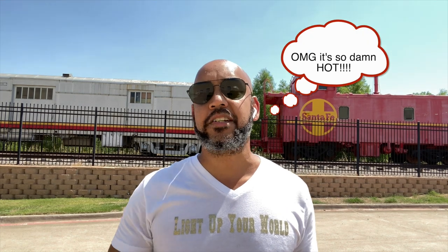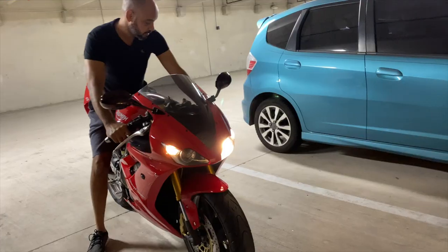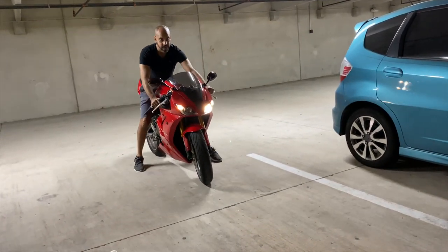The next step up was for the headlights. Now, we could have easily dropped in an HID or LED kit. However, we wanted to maximize our light output and our visibility. Typically, the low beams and high beams are separate, which means that when your low beams are on without the high beams being on, only one side is on. I've never really been a fan of seeing one headlight on, so when we purchased this bike, we decided, okay, let's go ahead and install proper retrofits, so that not only we improve in our lighting, but aesthetically it's a lot more pleasing. And now we have not only dual low beams, but we now have dual high beams as well.